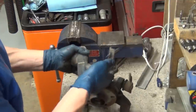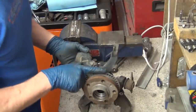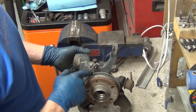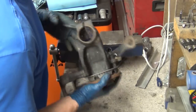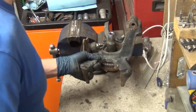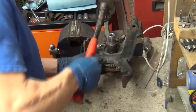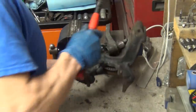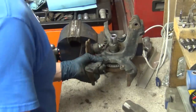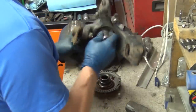What I like to do — I'll set them on the ground here. This little exciter ring keeps your ABS sensor safe; notice I don't pull that out because these never come out — they just rust in there, forget it. I'll set this up in here and I want to make my hits count. When I hit, I'm leaning down on it — kind of Babe Ruthing on this thing, squeezing the hammer hard and just leaning on it. First hit, don't expect much. Second hit, you should get a little movement. Third or fourth hit, it's going to drop. Just like that.